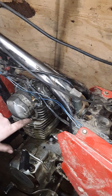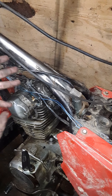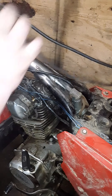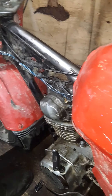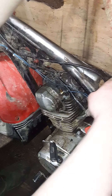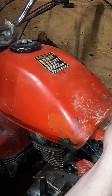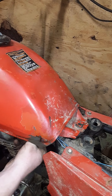We're back. I cleaned it up a little bit. Now let's put the gas tank and seat back on it. Let me get these wires out of the way. The gas tank has these two little nubs up here — I suck at camera work — that catches them. You just push this up, and then there's a little tab back here you just push down. And now all I gotta do is put the gas line on it.